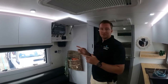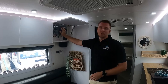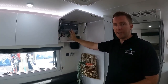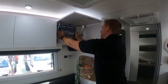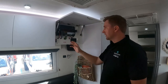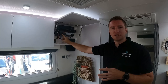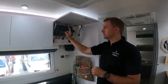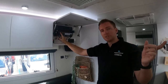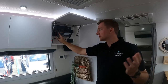Okay guys, so the brains of this system — you've got your screen which does all your control. This unit here actually controls your network and is known as a COI, or combined output interface. They're a really nice bit of kit, really easy to operate. Essentially there are two things: we've got a MOSFET switch which is what switches your circuit on or off. It's a load-monitored device, which is why you see your load on the screen — so your fridge is drawing four and a half to six amps, whatever it may be running at the time.